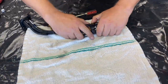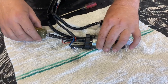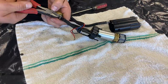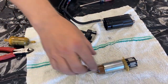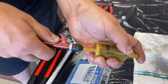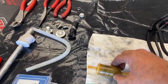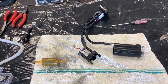Now we've got it all apart. We can get our fuel filter off and get everything out of the way completely. You can actually see it squirt out right there at the seam of the filter — I can feel it with my finger coming right out of the filter. So that's our weak spot. In this case, the fuel pump is probably just fine, but since we have this complete kit, we're going to swap it all out right now.